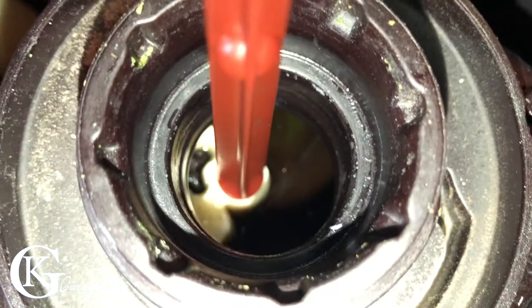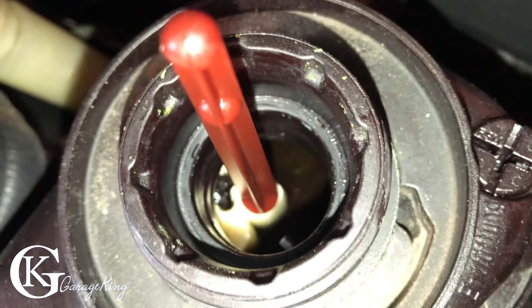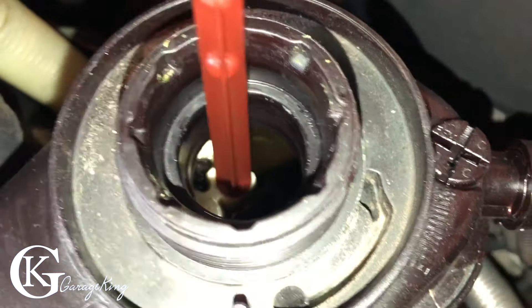So now what I'm going to do is I'm going to let off. We're going to go under the hood and we're going to take a look and see how the water pump's running. So I've taken the cap off and if you look inside, you can see there's no flow whatsoever. Very dirty coolant — probably needs a water pump. We're getting no flow.